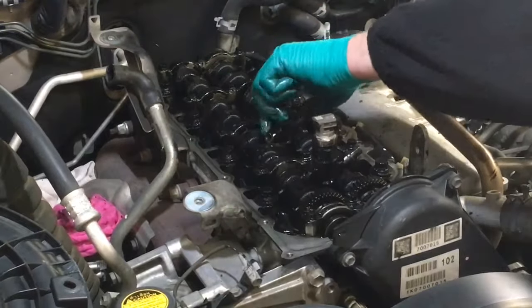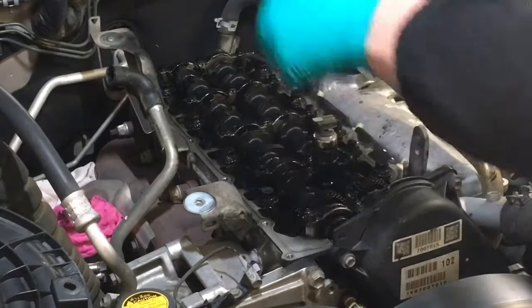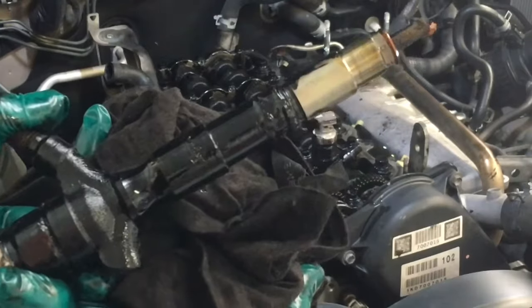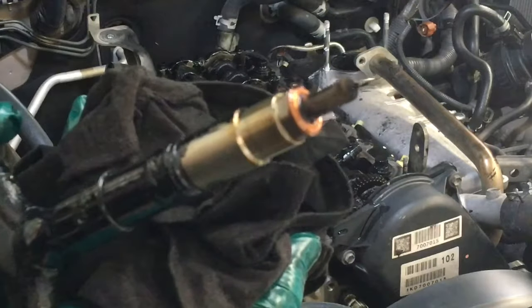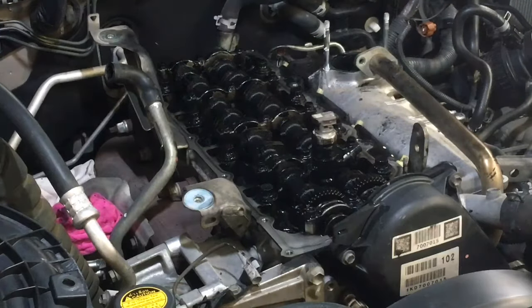The good news is, three came out. There's another one, full on sludge-o-rama. I'll show you that one as well. Right. Look at that, filth. And the original copper washer, of course, eh? The 05, 06, 07 engines had those. Okay, 2009 onwards, didn't have copper. I should say they didn't have plain copper. They had copper with a coating, as you've seen in other videos.